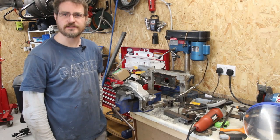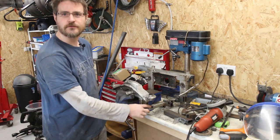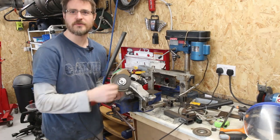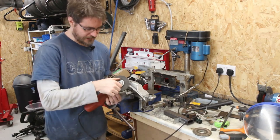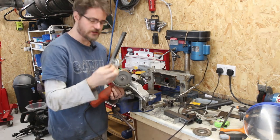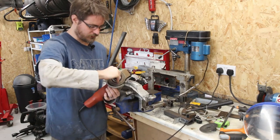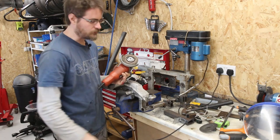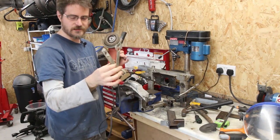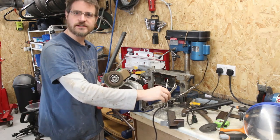That's the bulk of the bracket removed with the cutting disc on the grinder and a hacksaw and lots of elbow grease. The next thing is to finish taking off the rest of the bracket and the weld with a grinding disc. I'd like to give a quick shoutout here to Home Built by Jeff, a fantastic YouTube channel — he recently mentioned these quick-release grinder attachments. I'm not getting sponsored for this at all, I just saw it on his channel, thought it was a great idea, got one, and it's been brilliant. That makes changing grinder attachments so much easier. Another little tip: cable-tie your tools to the power cable for your grinder so you don't have to hunt around for them.